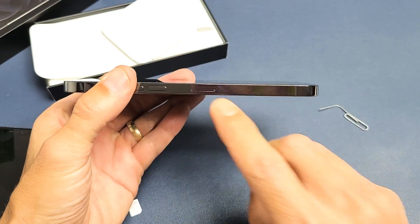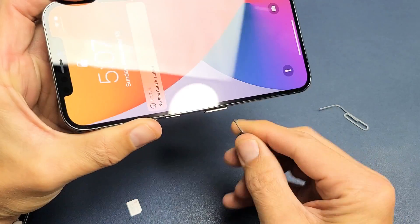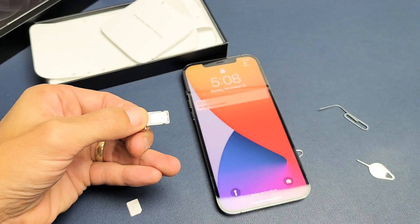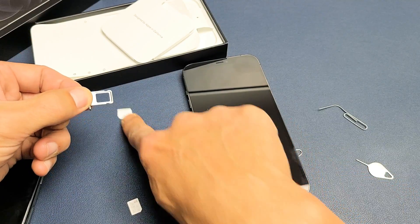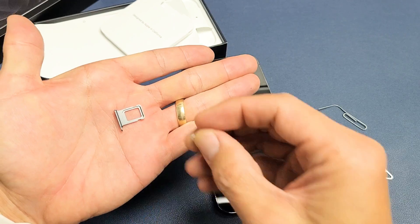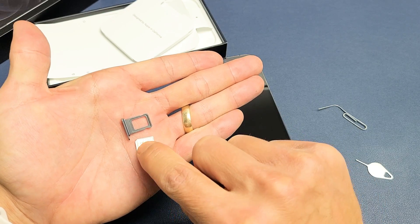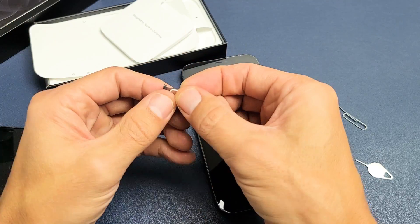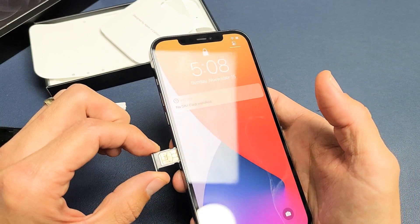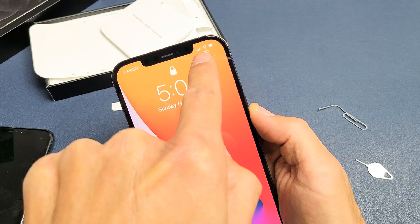Go ahead and turn the phone over and find the SIM tray. Put the needle right in there, press in until the lip pops out a little bit, then slide it out. Now there's a diagonal slit on the top left-hand side, so you want to match your SIM card. Keep it upside down with the metal contacts facing you and the diagonal slit aligned. Place the SIM card nice and flush, then insert the tray slowly. I'll wait until I see reception bars — T-Mobile — that was quick.